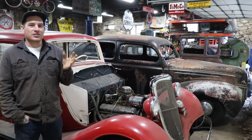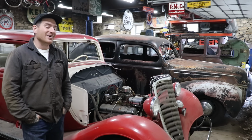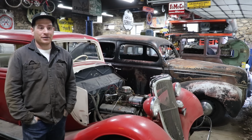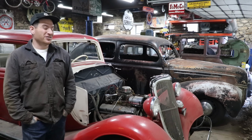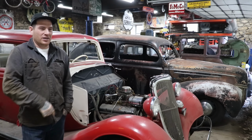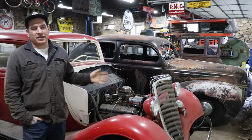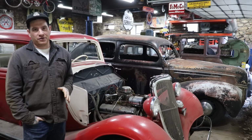So the last video was a little bit of ups and downs. We got the oil pan cleaned out, and I got all the gunk out of there. The oil pump was good, or looked good. Put everything together, got it cranked up, got oil pressure, but we found that there was still some water in the engine, and they had epoxied those pipe plugs into the block drains, which is a little scary. But at this point, we don't really know unless we get the engine running if it's good or bad. So I'm gonna keep pushing forward because I want to hear this thing make noise.